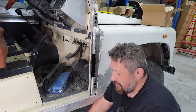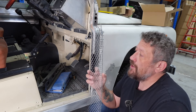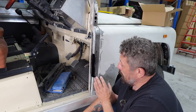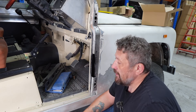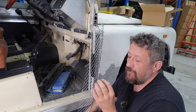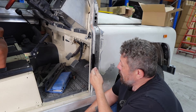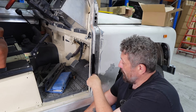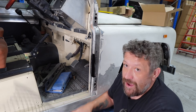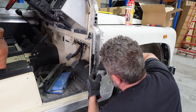In the past I've used aluminium mesh, which works really well, but for this job I got a massive roll of galvanised bricklayers' support mesh. I'm going to use that to create something to fill the void in here, because what I want to do is put some resin fibreglass in there to create the shape. By using mesh instead of expanding foam, it will still allow any moisture or water to run through — because something clearly stopped water escaping before, whether it was old rotten dirt or whatever.